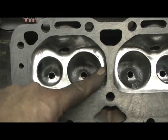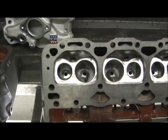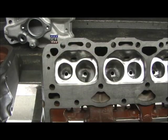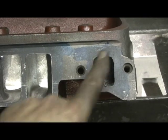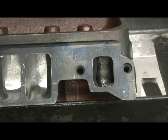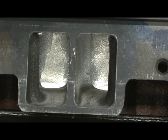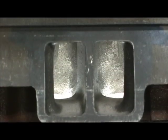Don't forget all of our combustion chamber mods — unshrouding the intake area. The heads were surfaced. I also took a sand roll after surfacing and rolled around 120 grit around the edges. You can take your hands and go right across it — it's all smooth to the touch, no chance of detonation. Let's get one more shot of the intake side from the flange. Notice that I even do the water ports — I scribe the lines and go in there and really port that. I really go in there and open that up so I've got a good water return. I really concentrated on shaping and width. It's about as straight a shot as I can get — lined up with a 1205, pretty much a straight shot till it begins its swirl and its twist.